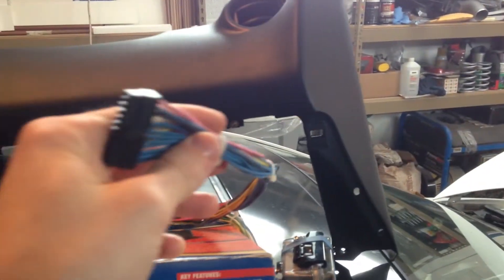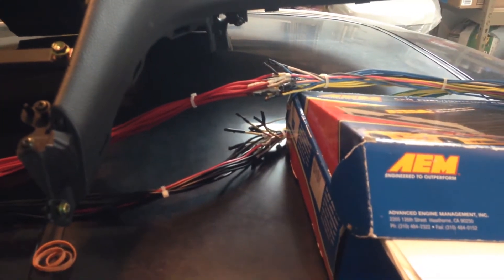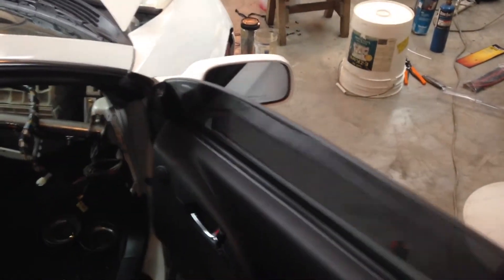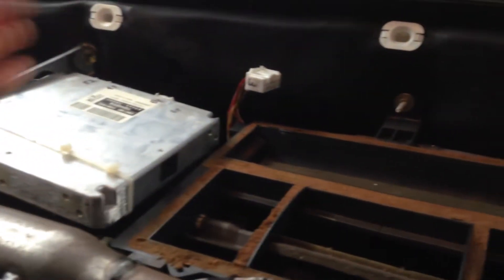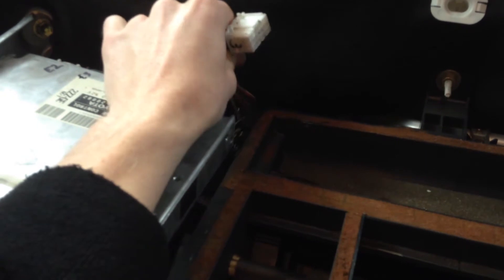I finished extending the FIC harnesses — the pigtails that came with the FIC. I have all of these extended, and any wires I'm not using I just taped off. All the ones I extended I labeled, just to make my life easier when I go in to wire it inside. This is going to be a little tricky because of the way I have my harness routed from the wire tuck — I'm going to have to cut and solder back near the firewall, which is kind of a bummer.